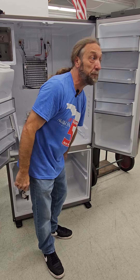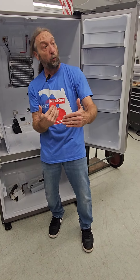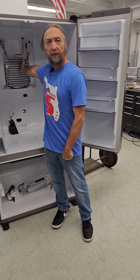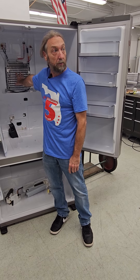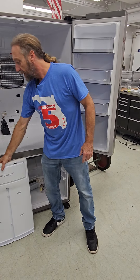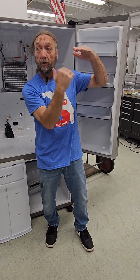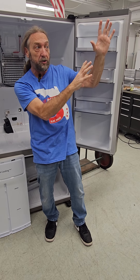We only run at 15 below zero because we want zero degrees in the freezer - the evaporator has to be 15 degrees colder so that the air can get to zero. But what temperature are we trying to achieve in a refrigerator? About 34 to 36 degrees. The closer you can get to freezing without freezing, the better. So on a Sub-Zero, they run the pressure around 22 to 25 PSI, putting the evaporator at about 20 degrees. It's just below the set temperature - cold enough to absorb heat from the refrigerator and get 34 degrees, but not as cold as minus 15.